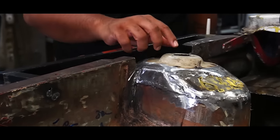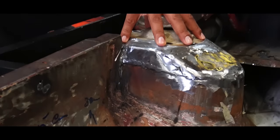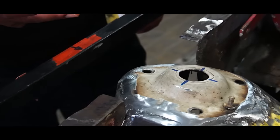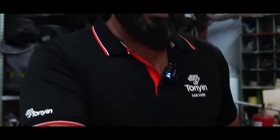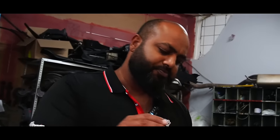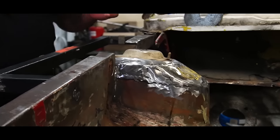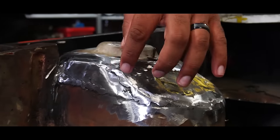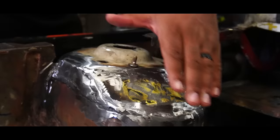So if you guys see here, this is a Golf 7 GTI shock mounting, and we've actually moved it 5 centimeters, and I think 3 centimeters up. So we've raised it a little bit because we also want to drop the car, because the subframe on the Mark 1s are lower than the chassis. Yeah, if I'm correct. Now, if you can see our weld fabrication, this has been custom made. This whole section has been welded and fabricated with a slant, so it looks neater.